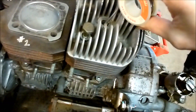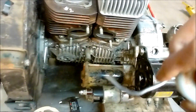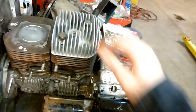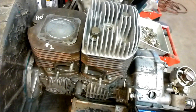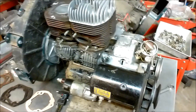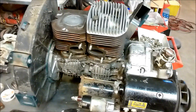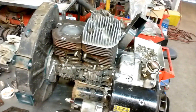You can take a roll of solder — big solder like this — put it in there, turn the engine over, squish it, and then measure the thickness at the quench area to see what you get. You should be around a millimeter or a little more. That's what I'm aiming for. I've got to pull these barrels off and stack some base gaskets to check my clearances, squish, and port flow. Thanks for watching.